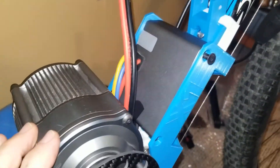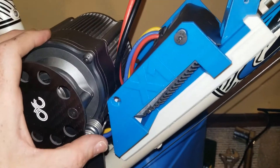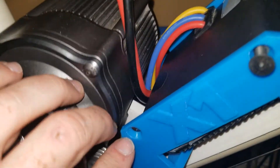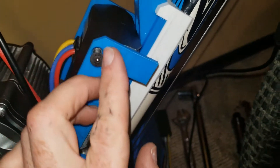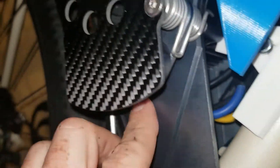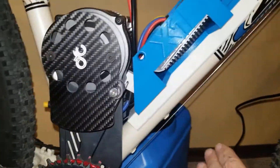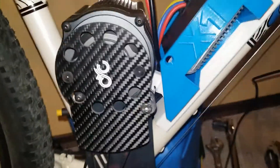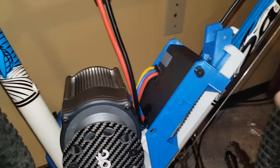The controller is on. It was a little more fiddly than I thought because it's quite tight in and around the back. We've got the battery lead coming up to where the battery will sit, phase wires going down there, and the hall sensor is tucked down at the bottom. These are just the fixings that came with the original controller — they used to go in the side of the motor housing when it was positioned underneath the down tube.